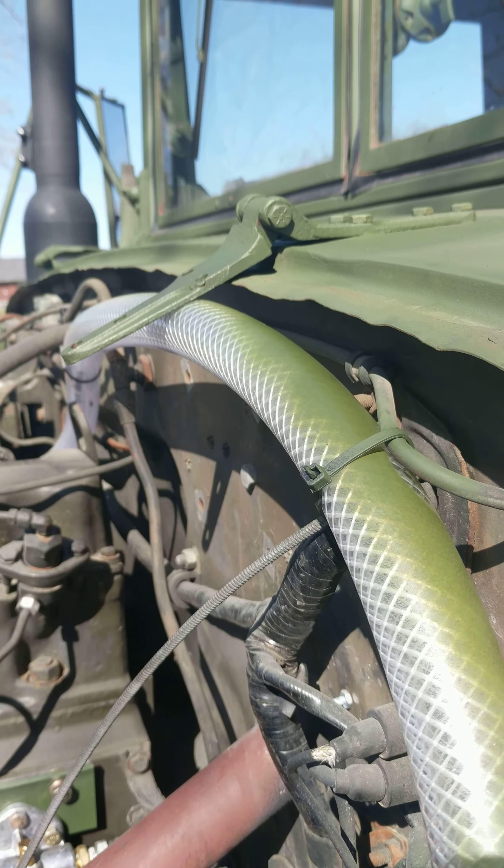I painted them while they were hanging on the truck. When I knocked out the hot rivets, I replaced them with these — they're five-sixteenths, two and a quarter inch length, so the shaft is long enough to go all the way through so the hinge can keep articulating. Then I zipped off what was left on the threads after I had the lock nut on there. It doesn't look the best but it won't rust anymore and it'll last.